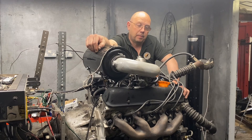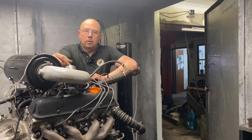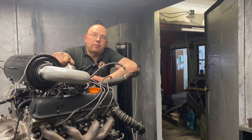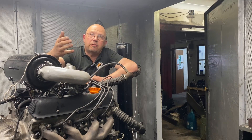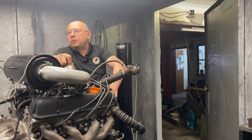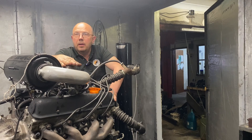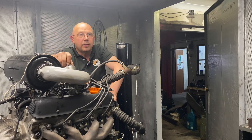It's not going to be a street racer's car, so we don't need a high-RPM rocket ship engine. What I thought I'd do is give you a very brief walk-around of the engine on the dyno. This here being the 4.6 — to look at the engine itself, there's almost no difference to the 3.5, certainly not externally when it's dressed up to fit in the P6. One difference is there's a hole in the block where the 4.6 would have had a crank sensor. And two, this block is cross-bolted — bolts that tie into the main bearing caps to support them from the side.